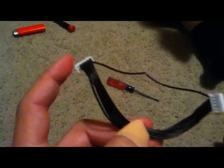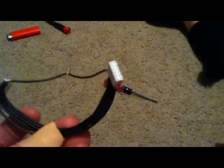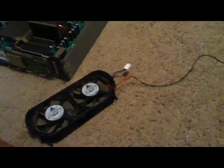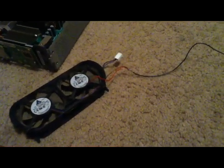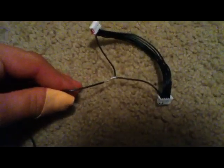See this? This side is connected to your disk drive, and that side is connected to your motherboard. Then you're going to want to take your red and brown wire that's connected to your fan, that you just twisted together, and twist it around your extra wire that you just stripped, and then take the other end of it that's stripped and twist it around your disk drive wires.